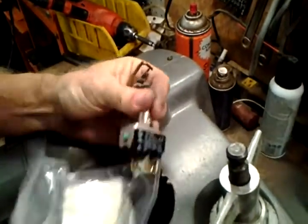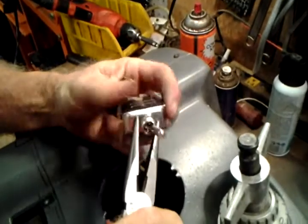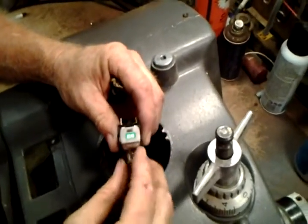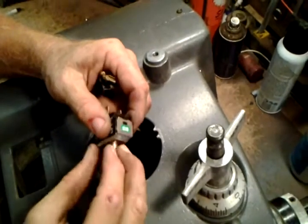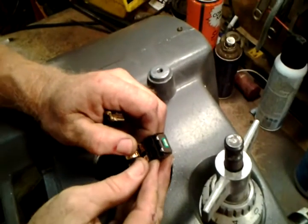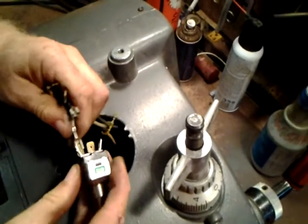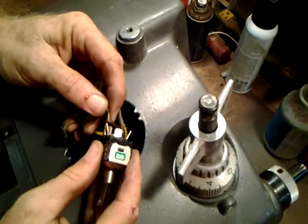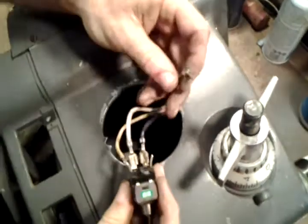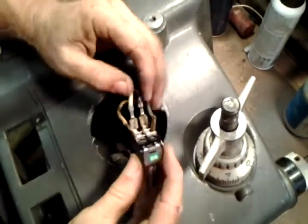There's the new switch. I'll remove this nut — this is going to be our new locking nut because the threads are different than that old-style nut. I like this switch better because the terminals are a lot more secure. They don't swing. They're very secure. Sometimes I've had to spread these upper ones out just a little bit, but usually not. Just put the two light colored wires on one side of the switch and the two dark colored wires on the other side. If your terminals or wires are bad, of course you'll have to replace those, but these all look good.